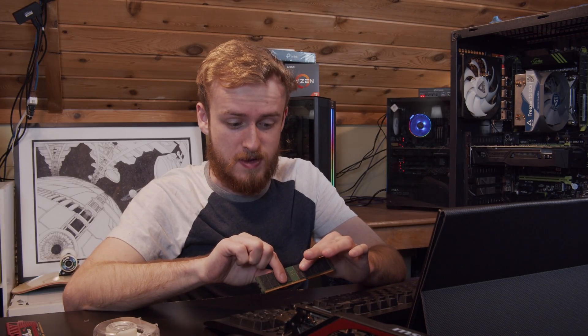Let's try it now. Does this boot? Yeah, I don't think it's going to boot on the first try. I really don't. I think even with tape on the very corner, it's not happening. It boots without the corner of the CPU! What I find very interesting is that in the industry when we have a CPU and we're done testing it — like the experimental versions — you'll trim or cut the CPU on the edge. But in reality, this proves that doesn't really do anything. I'm sure there is something wrong, like maybe ECC memory mode is messed up, but the CPU still works. It kind of defeats the purpose of trimming review samples or experimental samples so they don't get into the wrong hands.